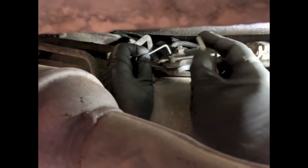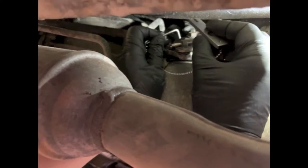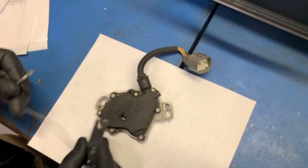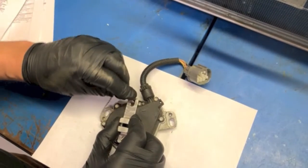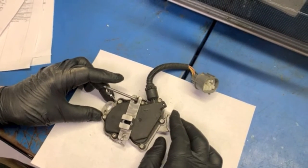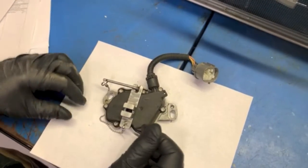So anyway, that's where it would go. You get your switch installed — you get two elongated holes, we'll show you on the bench. This goes over the selector shaft with the nut off, then this pin lines up into a hole up there, and that's how you would time your switch according to the direction specified. On the bench: no nut on the selector shaft — this goes over like this, and this goes through like this. Work that in there, and the elongated holes will allow you to move this accordingly to get the proper setting of your neutral safety switch and time it correctly so that you don't have fault codes occurring in the system.